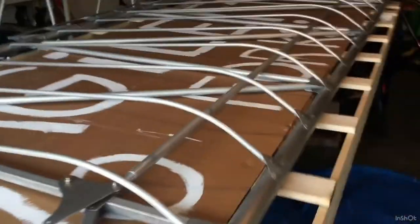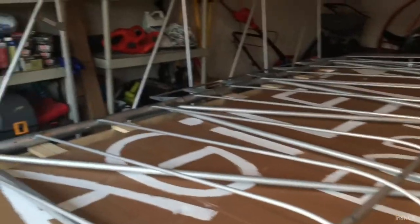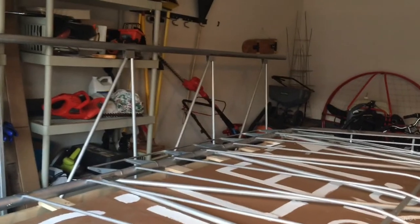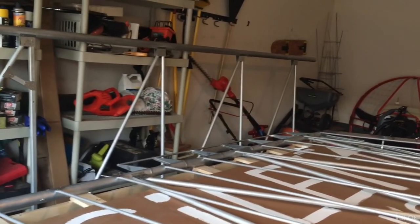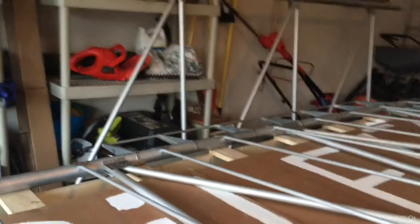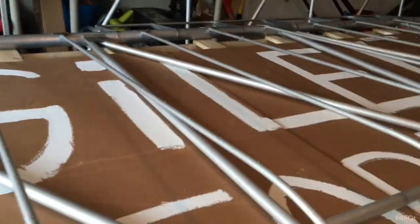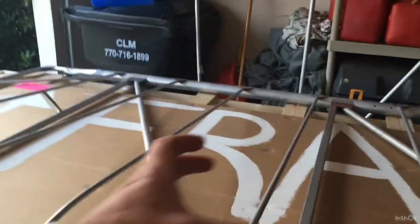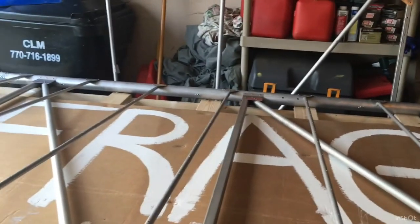I've done a little bit of taping on the gussets on the top side. I'll make sure all the taping is done, then fit the sheet for the bottom — we're going to cover the bottom first. What I really need to do is make sure the trailing edge ribs are really taped because there are a lot of sharp edges there. I'll take the mallet and mallet down some of the ends where the little tabs were riveted, make sure they're flush and smooth, tape it well, then put the bottom sheet on and cover it. The top sheet will go on from there, then the inspection covers and installing the ailerons — or maybe not until after I paint the wing and install everything once the fuselage is done.